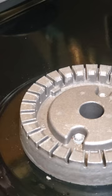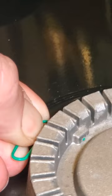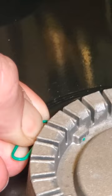So what I do is grab a little tiny paper clip — sometimes a needle will work or even an old earring — and just place it in that hole and clear it out so it's free of any obstructions. That'll allow the gas to reach the igniter and hopefully you'll have a working range again.